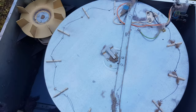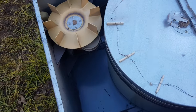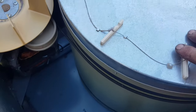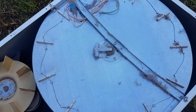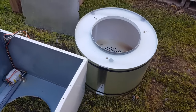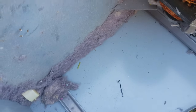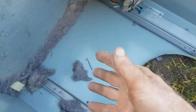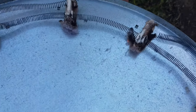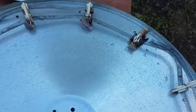For those who haven't seen inside a clothes dryer — it's just a simple clothes dryer, very minimal works. You've basically got an electric motor that belt drives the big barrel, and on the back is a heating element. The barrel lifts out very easily, and something of interest with this dryer: there's a large buildup of lint in the cabinet. The heating element had blown — which is why it was thrown out — but I'd say this dryer wasn't far off from starting a fire, so that's something to be aware of.